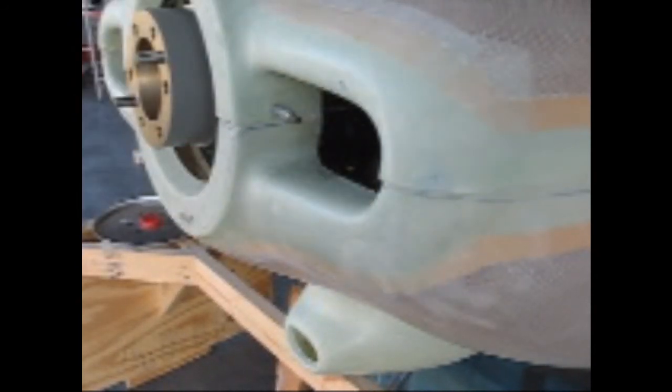Now I've done what they said to do, which is the same thing I did for the top cowling — draw this line and then draw an edge. But there's a problem right now with slicing that, and that is that the cowling fits under the bottom of the fuselage there. As soon as I cut that, all these dimensions are going to change. So the question I have is, which thing do I do next, since anything I cut is going to affect everything else?